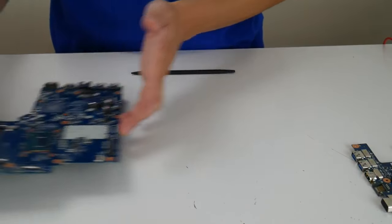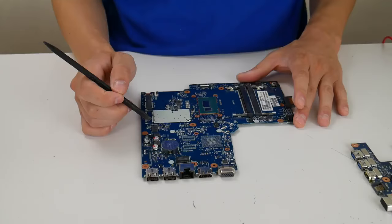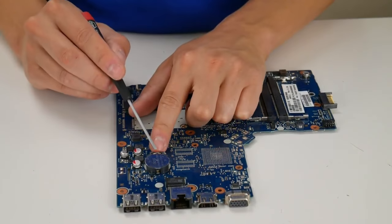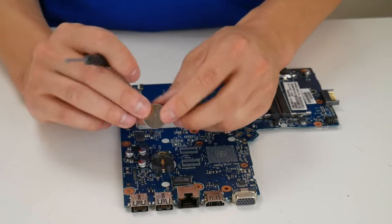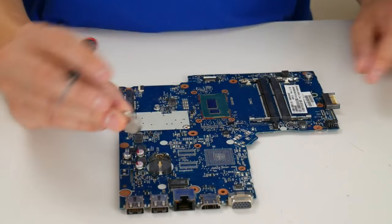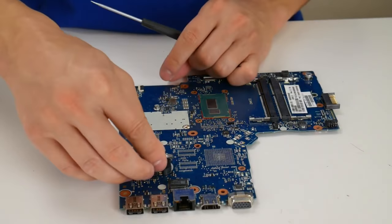The other one's a little more tricky. This one's actually plugged in like you would plug a battery into a normal object, but this casing that it's in and the clips that are holding it in place are breakable, so be careful when you're taking these kinds out. It's held in by a spring, so I'm just going to pull this back a little bit and pop it out. With CMOS batteries you usually have to push it to one side to get it out — either push it away from the clips and it pops up, or in this case open it up and push it that way to get it out. Be careful because this can break off. Again, you would take this out, leave it out for around 20 minutes, let the power drain, and then go ahead and put it back in.